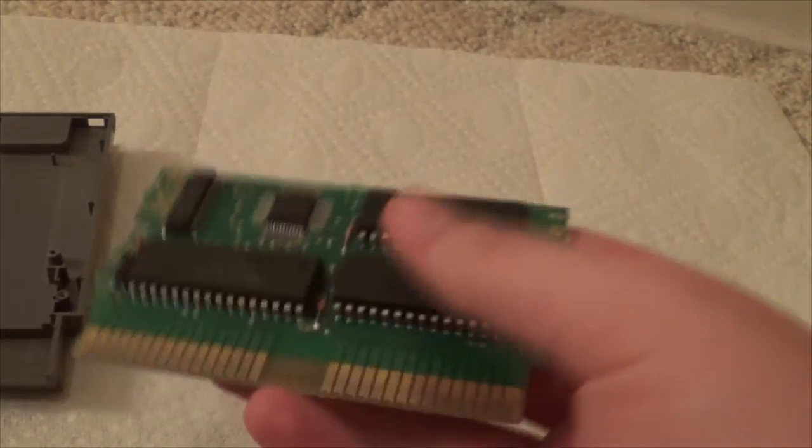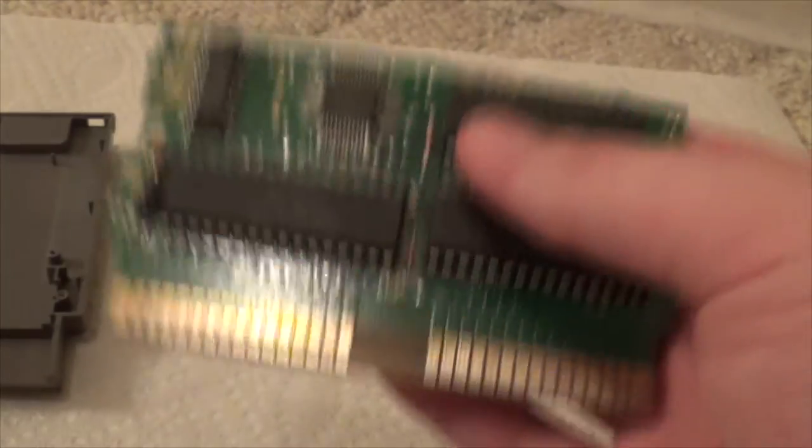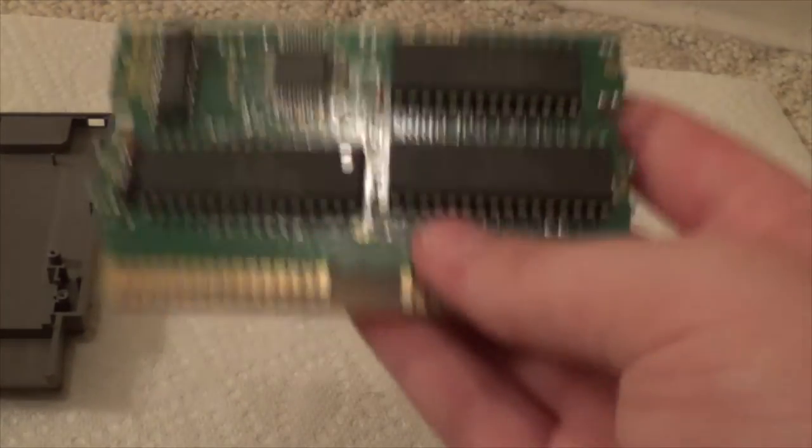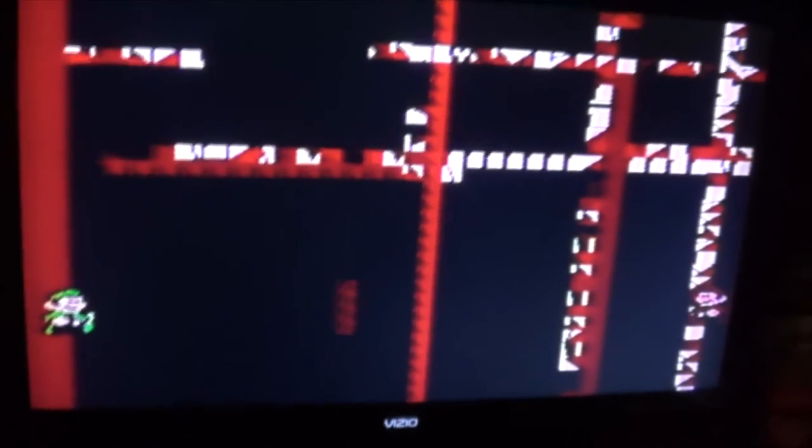I finished with the pink eraser. This method usually works on most games that are giving you a gray screen with the red light beeping, but it usually doesn't work on games that crash or won't work at all. Unfortunately this Mario 3 copy is still broken — I've used this method on many other games and it's fixed the gray screen issues. But this method is safe and I'd recommend you try it because it fixes a lot of otherwise broken games.